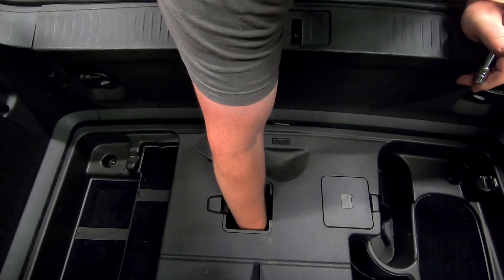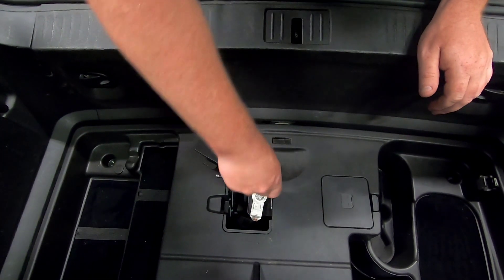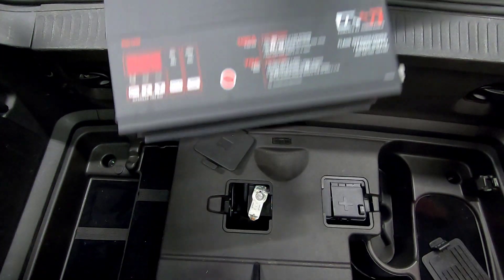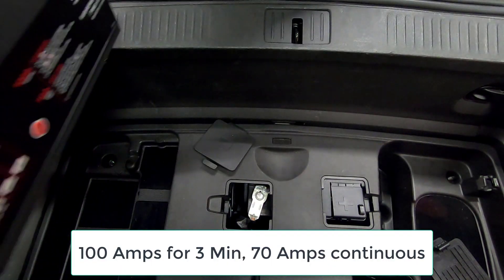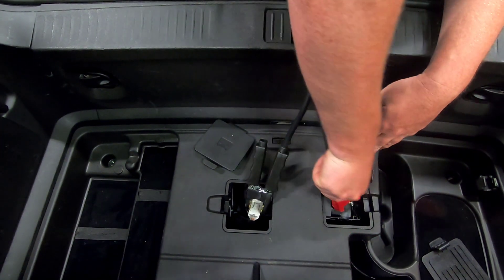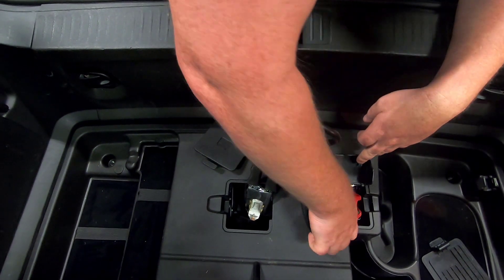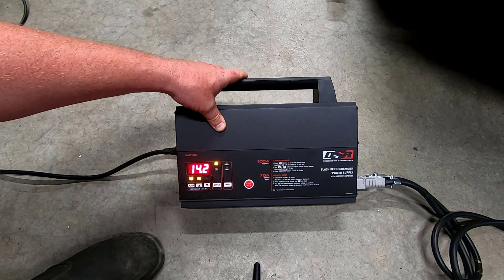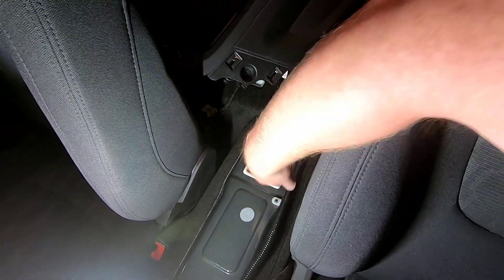Hook the ground cable back onto the battery. We have power. For this programming session, I will be using a Schumacher INC-100. This is actually capable of producing 100 amps of consistent stable voltage to the vehicle. We're going to go to flash — 14.2 is good, 13.5 to 14.2 is good. Start, and then that's going to power the car. Now I need to plug in the hybrid battery, and we're ready to go.